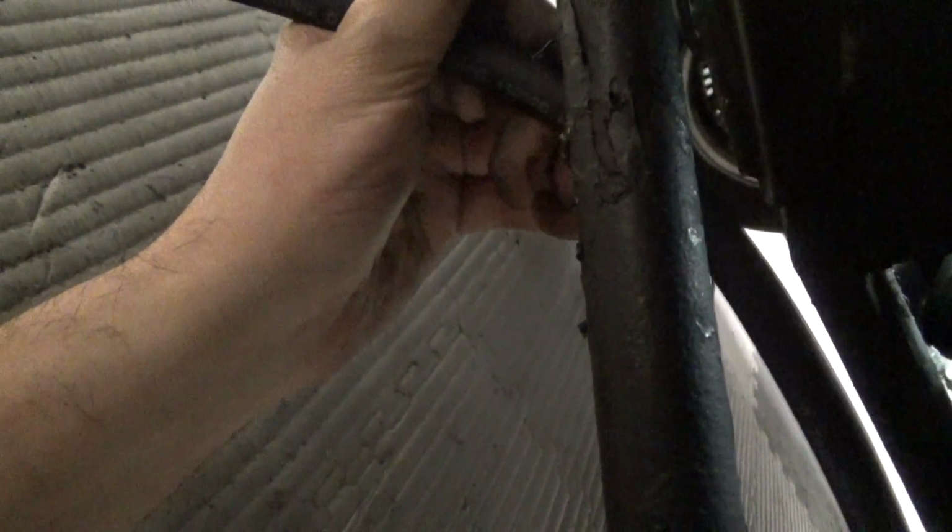So I think I've fished enough, probably more than enough, through. If I have to trim a little bit off, that's fine, or fish it back, that's probably what I'll end up doing. It's pretty easy. The way I did it was, as I was pushing through on the back end, I was pulling through here. So I had one hand here, one hand on the other side, and I would just slowly push it through. You just got to make sure that you don't start wrapping around your clutch line and the compressor hose that's in there. Just make sure that wherever you decide you want to route it, it's continuously along that path and not going up and down and all over the place.